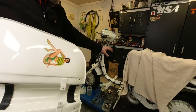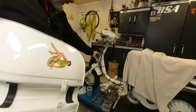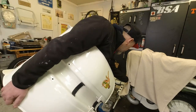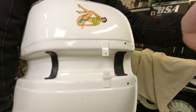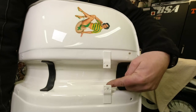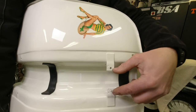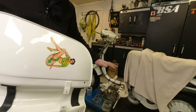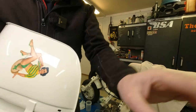The trickiest bit is you sort of lower the leg shields down — I'll show you how I do it. You do have to do a bit of bending, so you really need something covering your frame loop. Another difficult bit is trying to splay these out a little bit so you can get your cables on the inside before you fit them. When I fit it, I just fit it very, very loosely so I can move the leg shield. But first we'll attempt at trying to get this thing in.